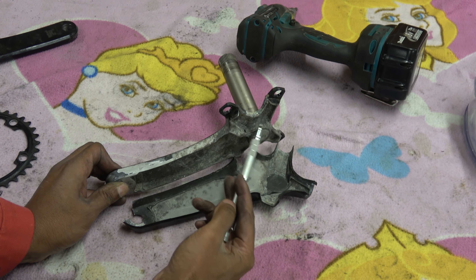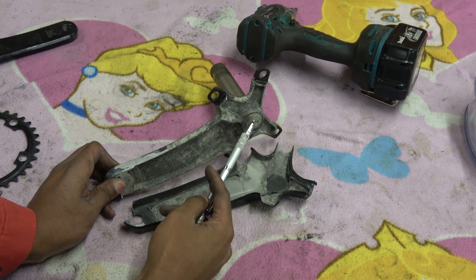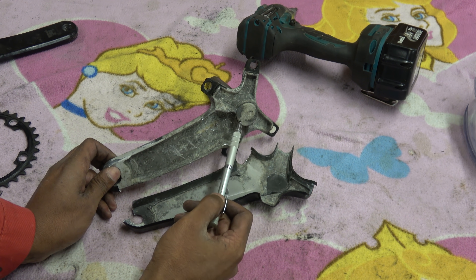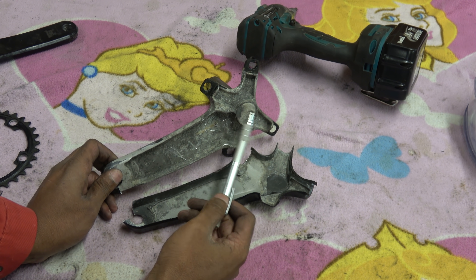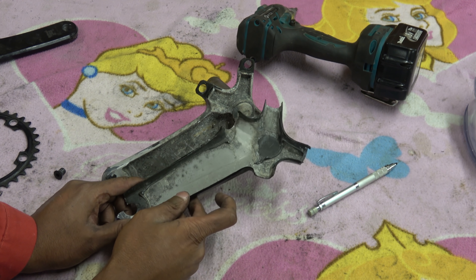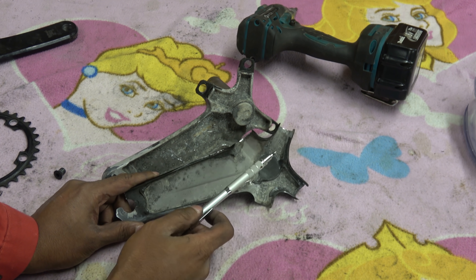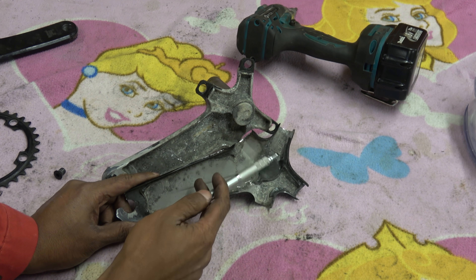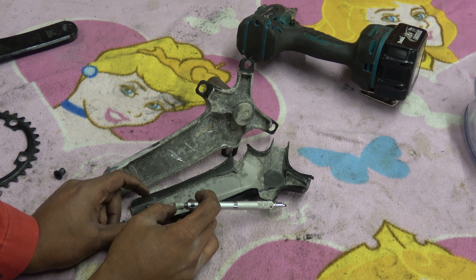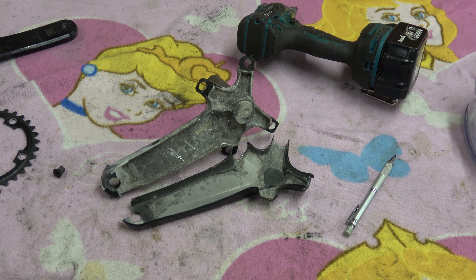You've also got a battery nicely set up because you've got steel onto aluminium, and that will create a galvanic battery effect. You're going to get corrosion products from there. Looking at this, the point where most of the corrosion is corresponds very closely to the steel section. I wonder if that is where the problem has started from.